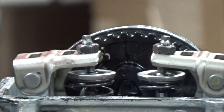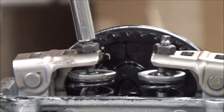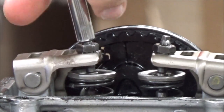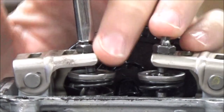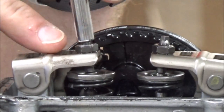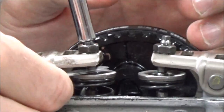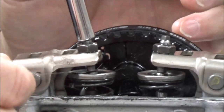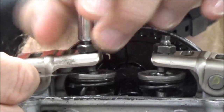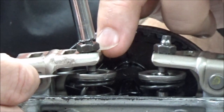I'm going to move this adjuster quick. Watch this — I'm just going to turn it with the tool and you'll see me actually opening it. It takes a lot of wrist movement to open that valve spring on about any other motor. Some people like to take the feeler gauge they want, get it in there, and then just snug it up. Make sure the nut is up far enough to where it's not going to bottom out and give you a false tightness right here.